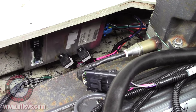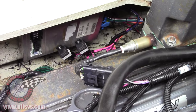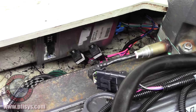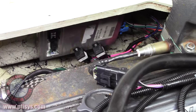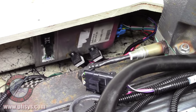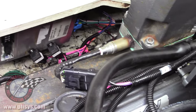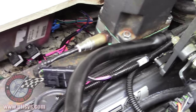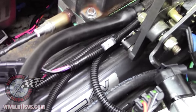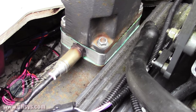As you can see, we've put the ECM on the side. There's a spot on the side of the engine — there's a storage area — and we've mounted it there. You can also see where we've installed the O2 sensor in the plate right there. That is the O2 sensor plate, and we screw the O2 sensor in the front.